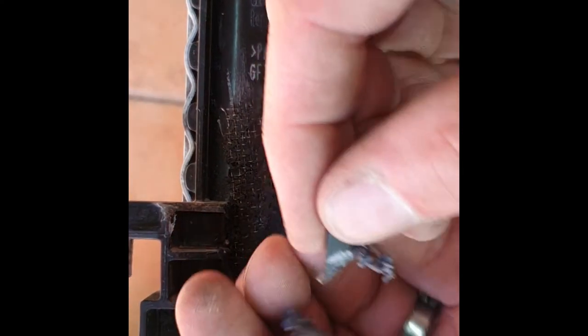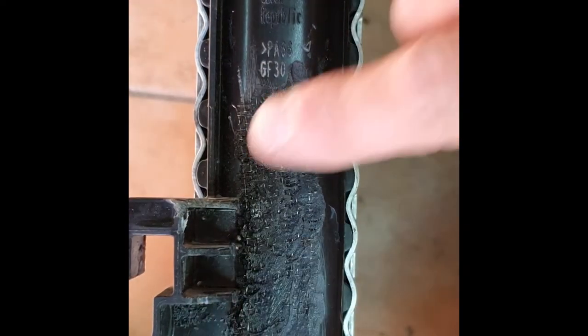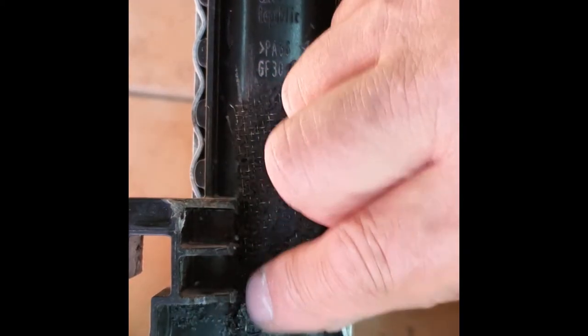Now what I'm going to do is use my little plastic pieces which I've managed to cut off of areas of this radiator, and now I'm going to melt them and spread them all over this to reinforce it.